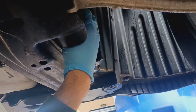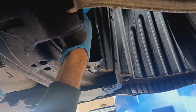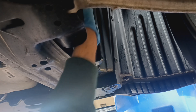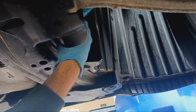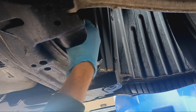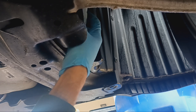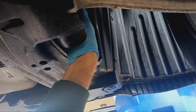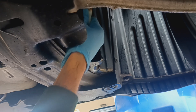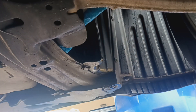This cover here, and the oil filter is right here. I'm gonna take the bag, loosen the filter up already, stick it in there and turn it. My bag is covering the whole filter, so when I loosen it it's gonna catch everything. I've got a pan underneath to help catch any oil I might miss with the bag. Right now it's dripping in there — just keep it upright and spin it. You can see the bag stays in place as you spin the oil filter, and you can see oil seeping through into the bag.